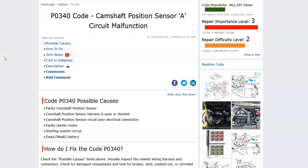What does this mean? Well, the camshaft position sensor reports back to the onboard computer the location of the camshaft as it spins. This is used for timing. So the car very likely won't be getting spark and it won't be starting, and it's going to have to be troubleshot as to why.